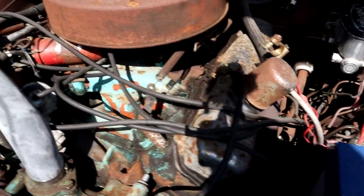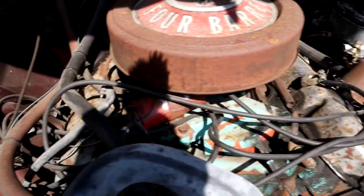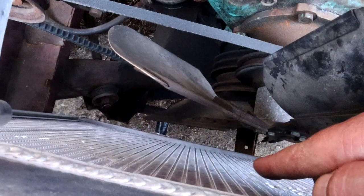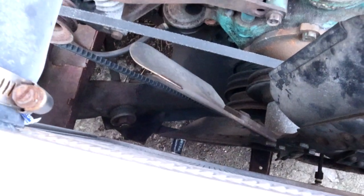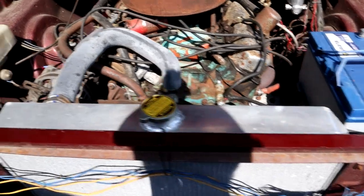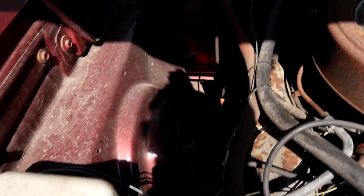If I can get myself out of the way so you can see in there — the engine's all original, no modifications whatsoever. As far as the running of the engine is concerned, it does run, it does drive. It just needs a couple of cooling pipes that run from down here on the bottom of the radiator. One is currently covered with a bit of rubber hose because it leaks — I unfortunately cross-threaded the pipe when putting it in the new radiator. I do have a couple of new cooling pipes to go on straight away. There's also a new starter motor — I'm taking the original starter motor off, which is way down behind the headers, and replacing it with a mini starter as most people do. Once that's done it should be able to fire up, start running and driving, and get back out on the road.